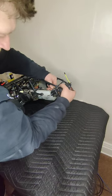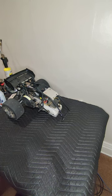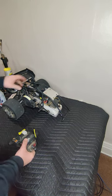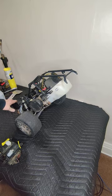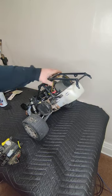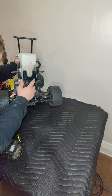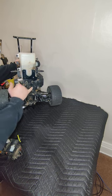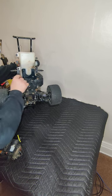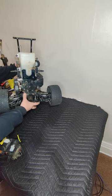I want to take that off too, because that's the other mission. See what kind of plugs this takes. I put this on the ground here. That's what it looks like when you have the frame off. That's what you need to do to get a frame swap. Let's see. Kind of look around on this thing. It's all good. The roll cage. But I got a broken bolt, so I got to figure that part out. See what I got to do. Maybe I'll get a left-handed drill bit on it. But they use steel bolts, and I think the hardened steel bolts and the aluminum nut oxidize together.